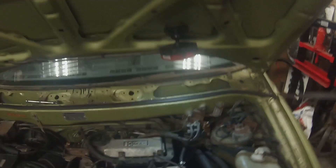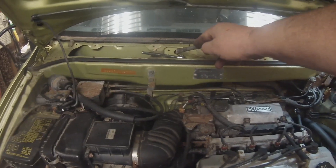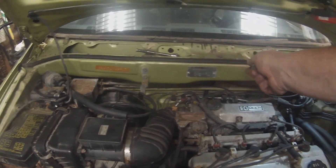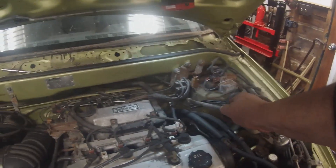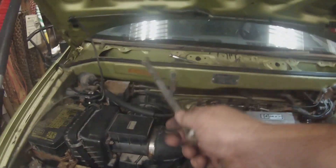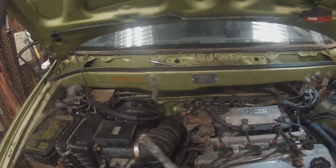I just noticed there's a third hole where the wipers come through - that's probably for a right-hand drive configuration, so the wipers would go the other direction. It's interesting to see it was originally designed as a right-hand drive car. Same with the brake booster down here - normally that's on the driver's side, but since it was originally right-hand drive, they probably just left it there. There's a bar under the dash that goes across to the brake pedal on this side. I had a '78 Civic that was the same way - it's just kind of weird being used to the brake cylinder being behind here.